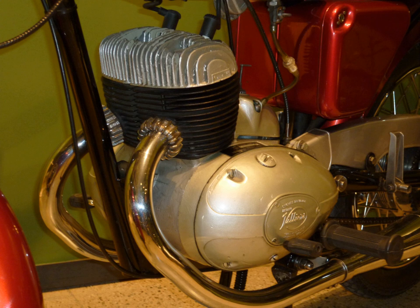The inline twin engine design has been used often during the history of motorcycling for both two-stroke and four-stroke engines, including the Dresch 500 cc monoblock and the Sunbeam S7 and S8. Although mounting the engine in line with the frame allows for a motorcycle as narrow as a single-cylinder engine, they also create a longer engine. A significant disadvantage for air-cooled engines is that the rear cylinder runs hotter than the front cylinder. For motorcycle racing purposes, they minimize the front area of the engine and chassis, allowing for a more aerodynamic and narrower front profile.